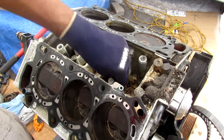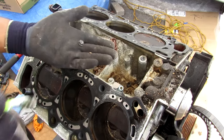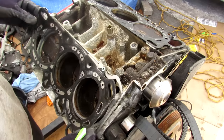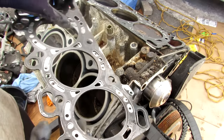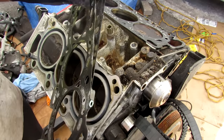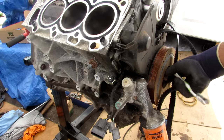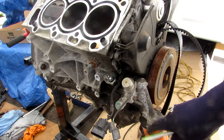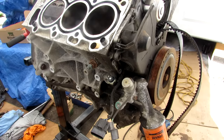Also down inside you can find some spare screws and bolts that have made their way down there over the years after working on your car. Here we've got the head gasket — you can see it's a multi-layer steel design, and these weren't really a weak point on the J series Hondas, it's more of a Subaru thing. In order to get this timing cover off I need to remove this crank pulley, but like most Hondas this bolt is pretty stuck. So I'm going to start disassembling the bottom end of the engine — we're going to flip this over and remove the oil pan.